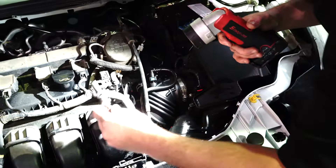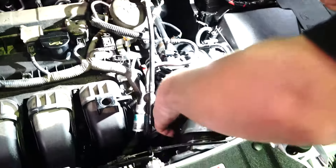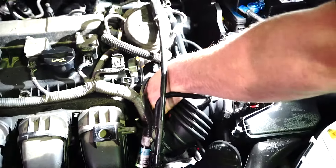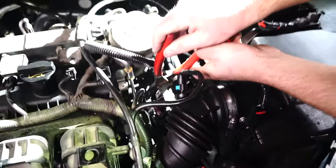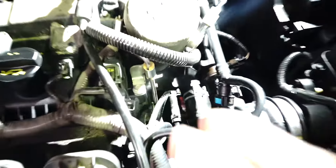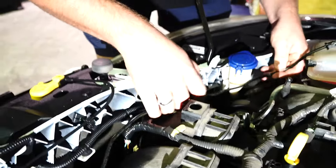Now it's time to do our secondary little hose — that goes under this intake tube, tucks over, and you can just reach through. Putting it back onto that little thermostat housing tube — again, you don't want to be snapping that plastic tube off, so this is a critical moment, probably the most critical. Nice pair of pliers, heaps of space, don't rush this. Squeeze together, drag it up and over, and give it a nice firm plant.